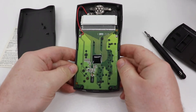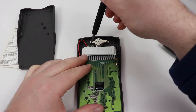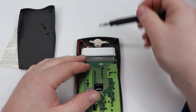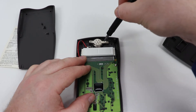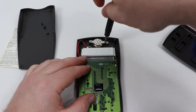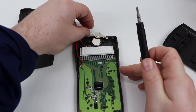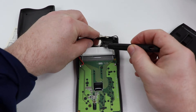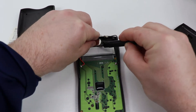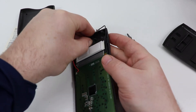This is what the insides of it look like. Up here is our battery compartment. It uses the same screw — this little tiny guy here. One of them you need to unscrew; the other one you just need to loosen up a little bit. Then you can just rotate this piece off to the side and the battery will pop out really, really easy. Of course, I said really easy — that's a little bit more difficult when you have a camera in front of you.